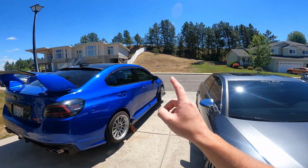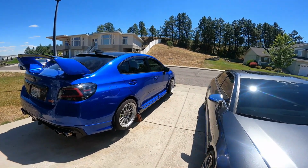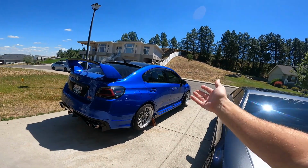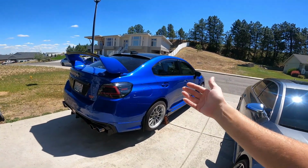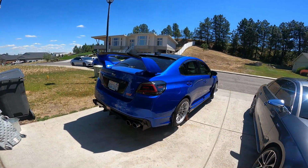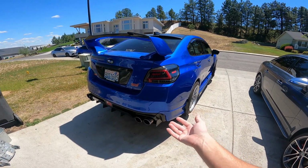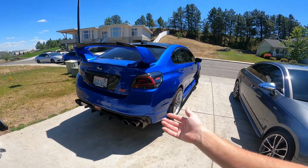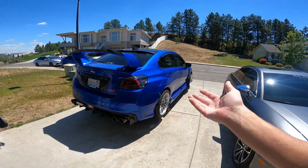He went to a V-band turbo later on, so they cut the T4 off of this and put a V-band on it. And with that, he had a custom downpipe made, because I had just sold him originally just the up pipe. So when he got the downpipe made, it was originally for a Q300 setup, and for whatever reason, the Q300 does fit a bit different than the Tomei. Whether that might be JR had his Tomei adjusted differently when he put it together, I'm not sure.